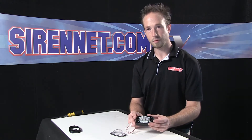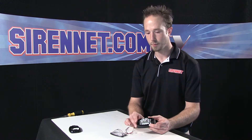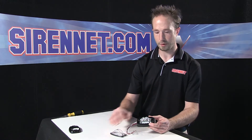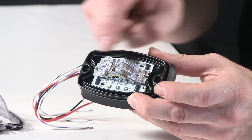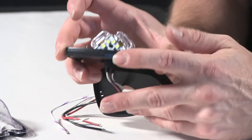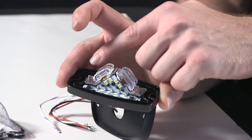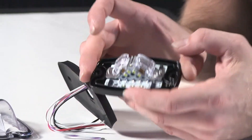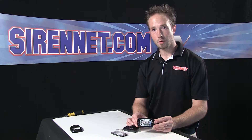The unit itself is constructed as a one-piece unit from Whelen Engineering. They put the unit together in-house as one piece, with the exception of the lens, and the rest of the unit inside is completely sealed. You'll notice screws and a wiring harness that enters the back of the housing, but when those are put together on the assembly line, everything is completely epoxied in, covered, soldered, and sealed. So you don't have the ability to remove any of the components from the cast housing.